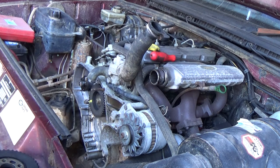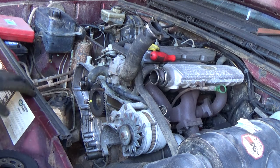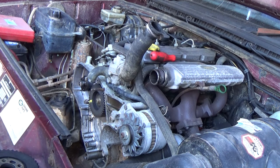The first one I did was in a Series Land Rover, which has a cross member underneath the chassis, so you cannot get a timing pin into the flywheel. With this — obviously it's a Discovery — I've put the timing pin in. Timing pins are well worth buying if you plan on doing this for a business or even just a couple of times yourself. This engine is relatively low mileage according to the odometer, and it looks and sounds it too, so it's probably only had 3 or 4 cam belts in its 28-year life.